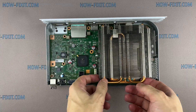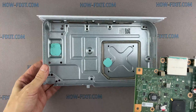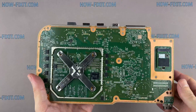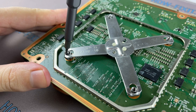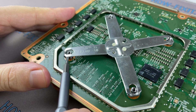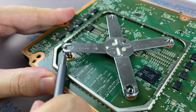Grasp the heatsink with your fingers and lift up the front of the motherboard. Now comes the most difficult step of disassembly — you need to remove the clamp that holds the heatsink. Insert a flathead screwdriver between the edge of the clamp and the heatsink pin, then slide the bracket up. Next, insert the screwdriver inside the bracket and pull to the side to remove the bottom edge of the clamp from the slot on the heatsink pin.